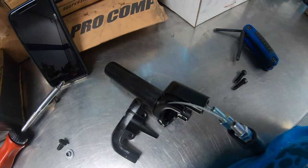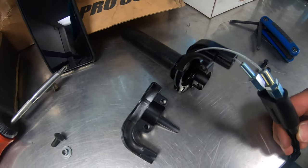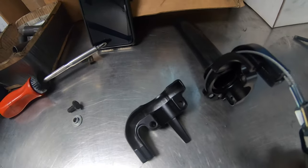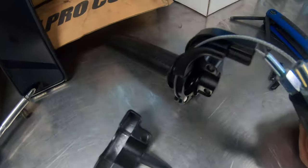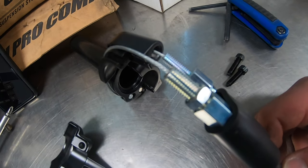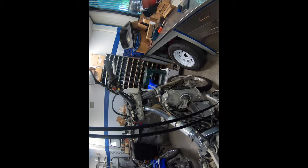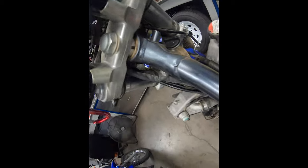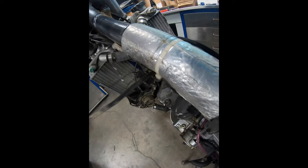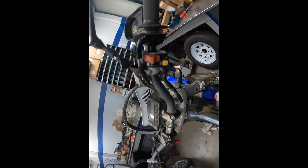All right, we're putting on new throttle cables that come with the kit — it's a full throttle housing and cable tube assembly. There are two different thread sizes — I want to say 5mm and 6mm — so make sure you get the cable on the right side so it fits the thread. It only goes on one way. It's best to test it off the bike first so it's not such a hassle. Before you install the new cable setup, check the routing you've got going on. These stock zip ties — just pull the little knob and reuse them; a lot of Japanese bikes use this.